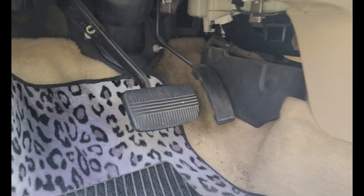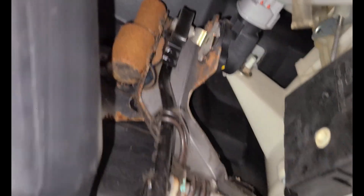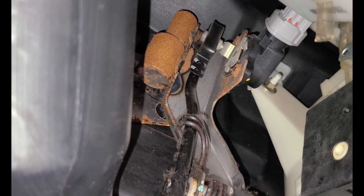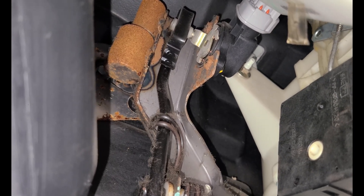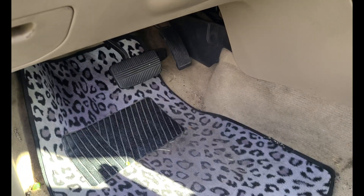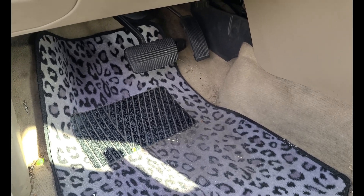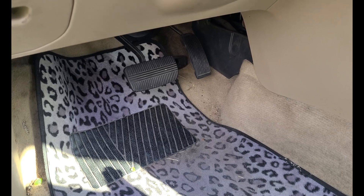The main focus at first here is going to be that sensor right there. It's black and it has a gray connector on it. It has six wires. It does come off of the accelerator pedal, but for some reason no one sells it separately — you have to buy the entire assembly, which is over $200 at the cheapest. So I'm going to start in there, probing and seeing if that sensor is any good.